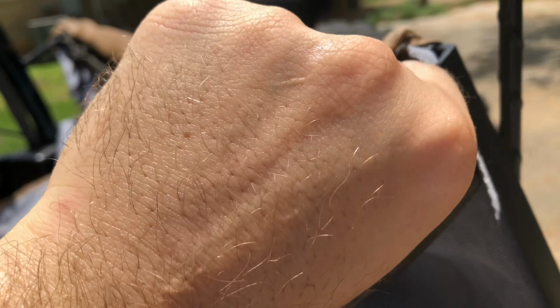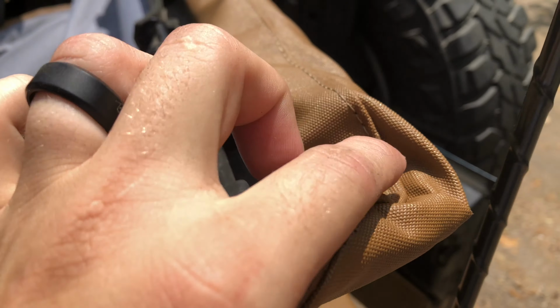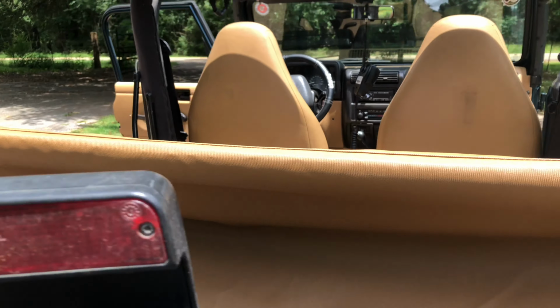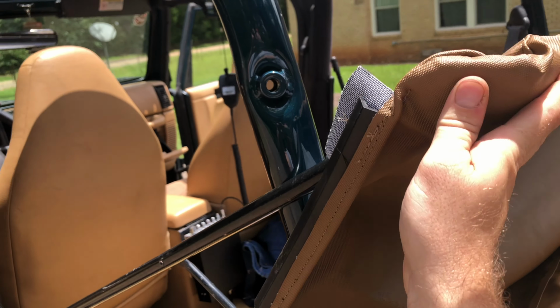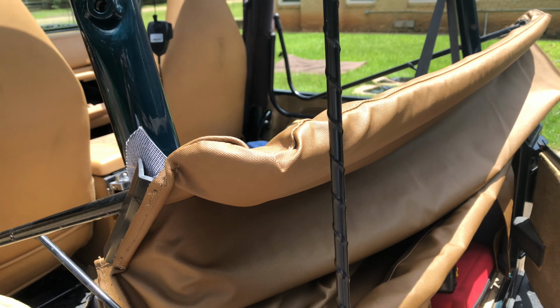There's that tab. And pull that corner onto there like that. Make sure it's all straight. After you get that nice and tucked and streamlined over there, you screw it down. So after you get them corners tucked like they're supposed to be, you're gonna pull your soft top up and put it down just like you're putting it up after you took it down.